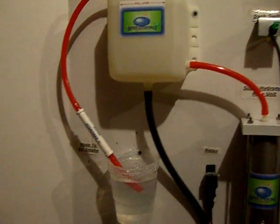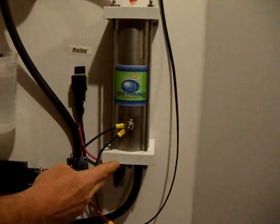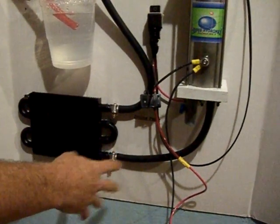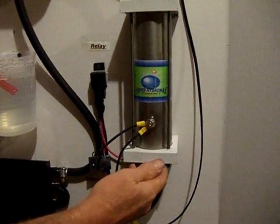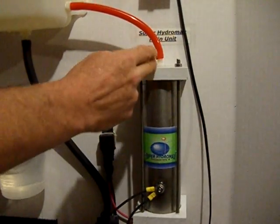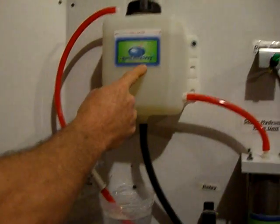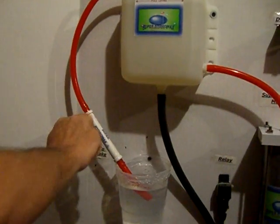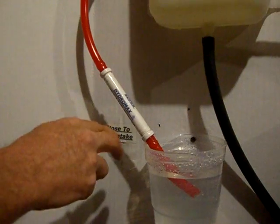What we've got is our main unit here. What happens is water comes from the tank, goes down through the radiator — which is in front of your car's own radiator — goes up through the unit. The water forces the gas bubbles out of the unit; the hydrogen and oxygen being produced go up through your water tank, which acts like a bubbler, bubbles through, and goes into your airline which goes into your air intake. This is our flame arrester — that's going to keep it from sparking back into your tank and prevent any possible explosions.